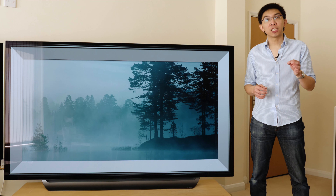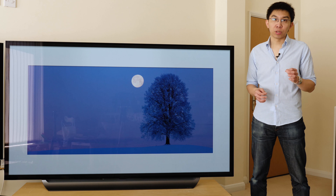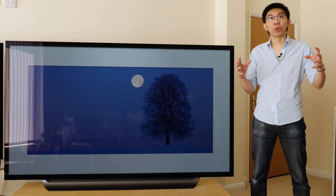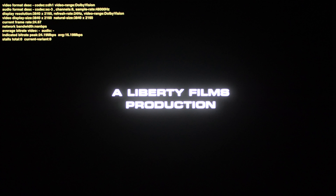Turning our attention to Dolby Vision, Netflix through the inbuilt app didn't exhibit any sign of elevated black level in previously problematic scenes, including the opening credits of Mute and the end credits of Mindhunter, suggesting that LG is using the latest Dolby Vision library. With an external HDMI source, however, the results depend on the interaction between the source Dolby Vision library and the display. Using the Apple TV 4K box, we saw some black level elevation and fluctuation in the opening credits of Mute. Bottom line: if you're watching Netflix Dolby Vision, try and watch it through the internal TV app rather than from an external source.